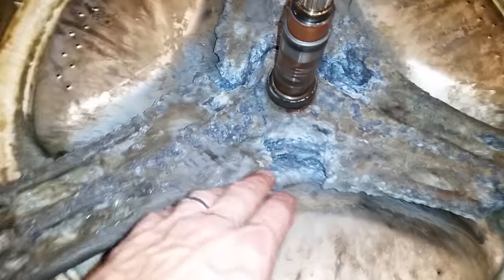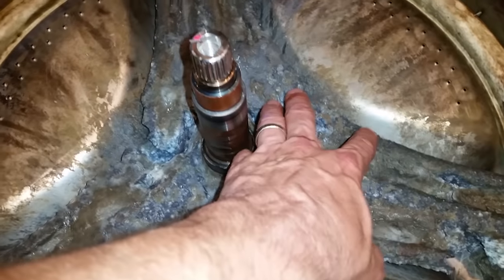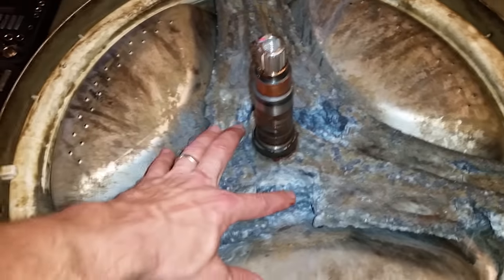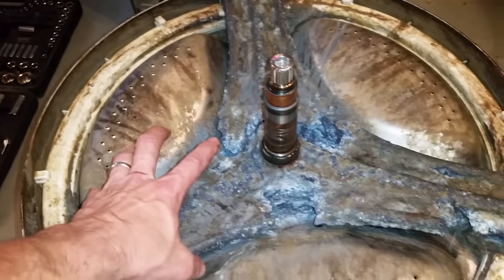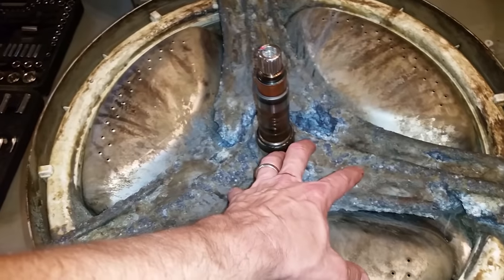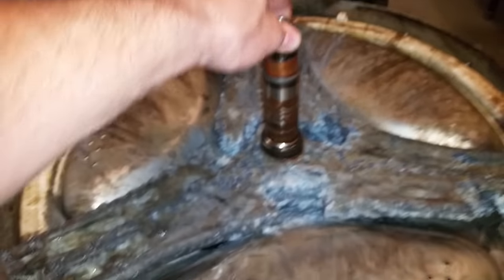As you can see, this literally just destroyed itself. This is not a mechanical failure — this is a chemical reaction between the two metals interacting with one another and deteriorating. And when that happened, you can see this is just totally loose, and that is what's causing the out-of-balance problem.